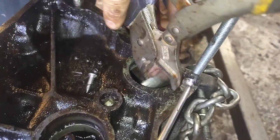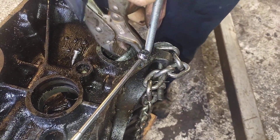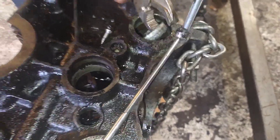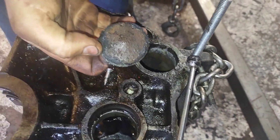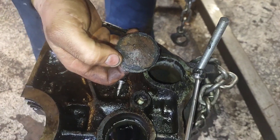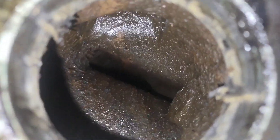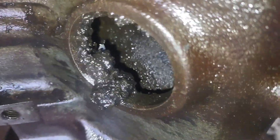Getting that one to come out of the hole a little bit — there it comes. Relatively clean, like I said. Being higher up, this is definitely answering a lot of questions I had about the sludge inside my overflow tank. Those are the water passages that go all around your cylinders inside the block. As you can see, these upper passages are relatively nice — it's these nasty lower ones we have to get cleaned out.